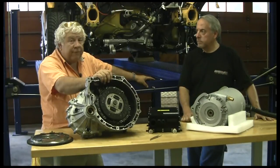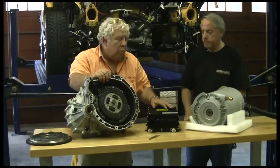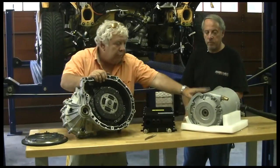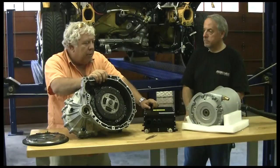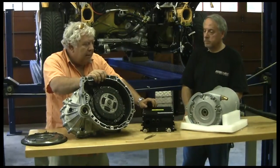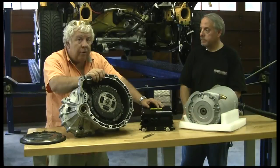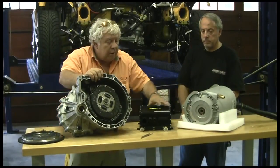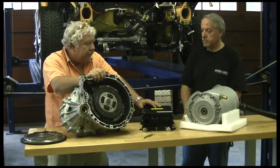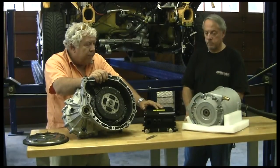AC motors are more efficient than DC motors. They have fewer parts. We don't have any of the commutator and brush situation where after 70 or 80,000 miles we have to change the brushes — this is almost a sealed unit. Less parts. There are AC induction motors that have run for over 100 years without rebuild, and I like that. The three-phase controller concept and the regenerative braking — I think that's the future of EVs, but right now they're quite expensive. This is $12,000 worth of controller and motor. I actually think this is a better system than Mini Cooper is using with the AC Propulsion system.